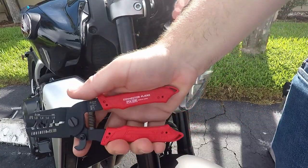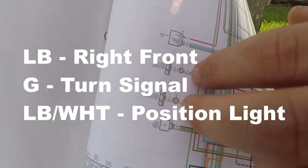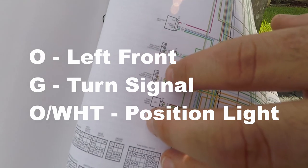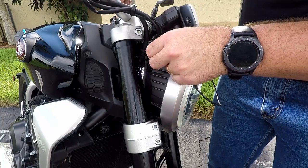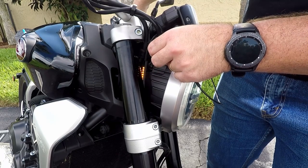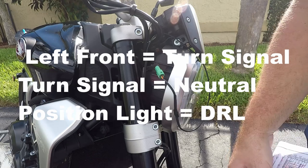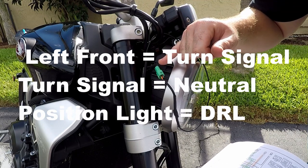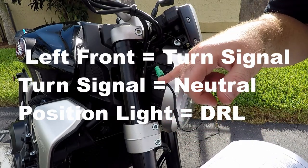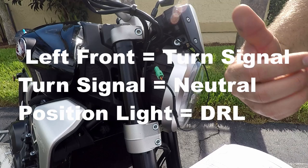Here are the turn signals. The OEM manual doesn't give a lot of good detail, but it says light blue is right front, green is turn signal, and light blue/white is the position light. While on the left, orange is left front, green is turn signal, and orange/white is the position light. Got the pinout figured out. With this particular setup I can deduce that the green wire is neutral. Since we're working on the right-hand side, the daytime running light is the red wire going to the blue/white wire — called the position light. The yellow wire is the turn signal wire going to the light blue wire. Now we just need to get it installed in the connector and then work on the other side.